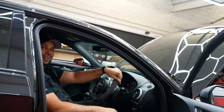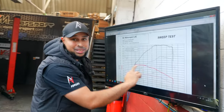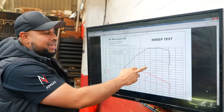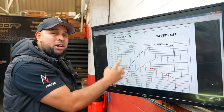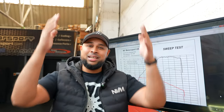That's how it should sound. Final results: 518 brake horsepower, 740 newton metres of torque. I've put a torque limit in there at 750 newton metres because of the stock internals. Nonetheless, you can see the delta gain — it's about 120 brake horsepower at the peak, but about 150 in certain areas, and a crazy amount of torque low down. So let's get it on the road, see what it drives like, and sign it off.